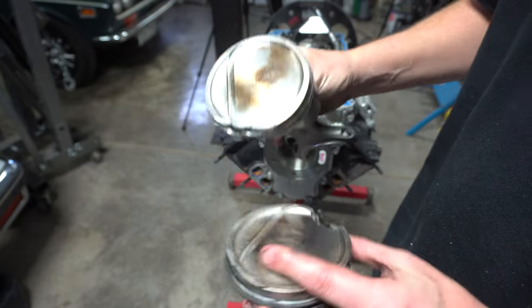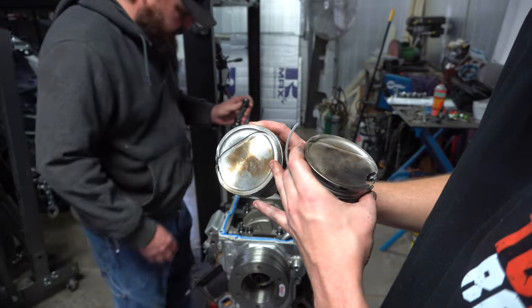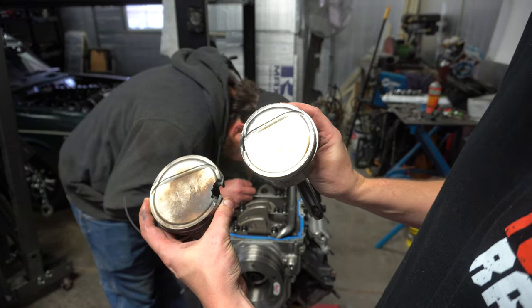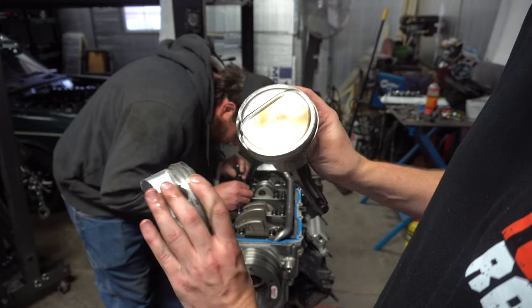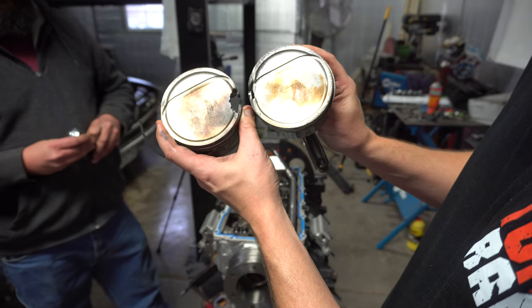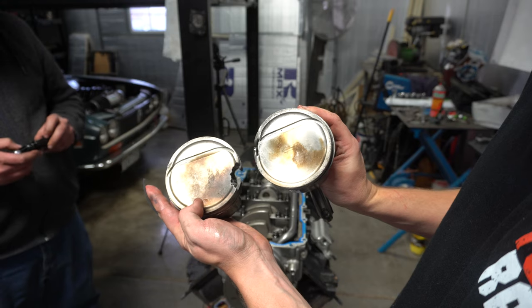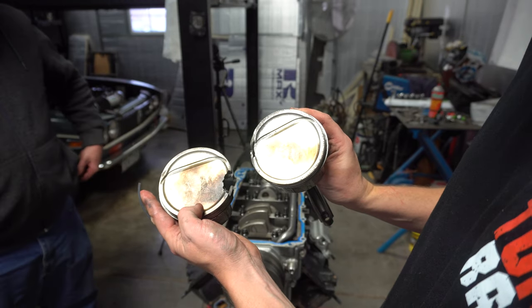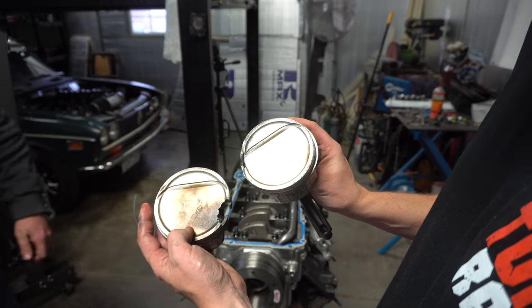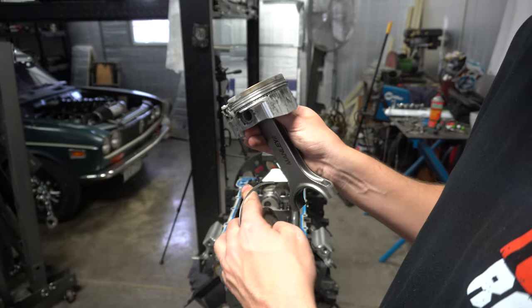This doesn't really show anything, which is what's crazy, so last time it melted the piston down in this corner, which again, this is 6, this is 5 this time. But it actually melted the piston where it lifted the ring land on that one. So the position of the ring land where it lifted it last time in that cylinder. So that's kind of interesting when you start looking at it like that, on how that worked out. So pretty interesting. But yeah, that's a melted piston, boys.